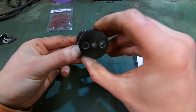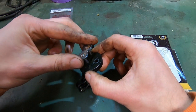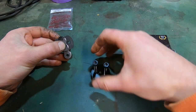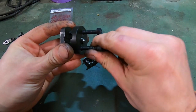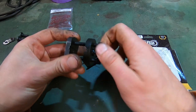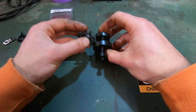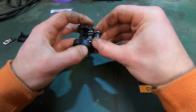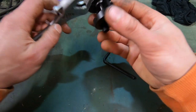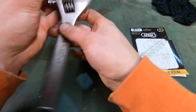Then put this side towards the chain link — because it's got a divot in here, the ends of the pins want to sit in there like that. So basically you squeeze them together and put your bolts through here. When you're trying to do this on the bike it's a little bit fiddly, but the chain itself is being held in place over the sprockets so it's not quite as fiddly as doing this freehand. Slot that in, make sure you've got it in the right place, then put the spanner on there — I had it on top so I could hold it, or downwards depending on where you're working.